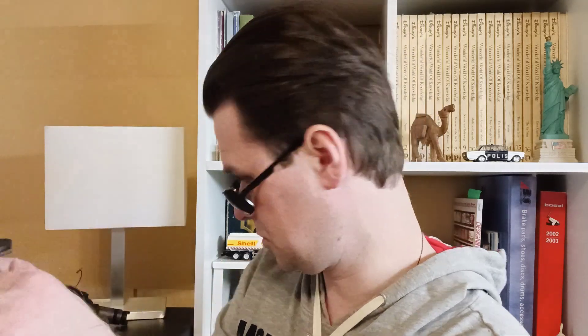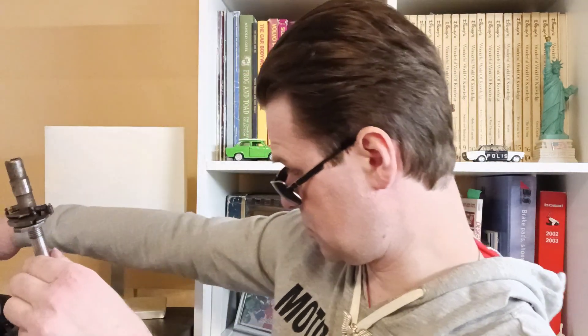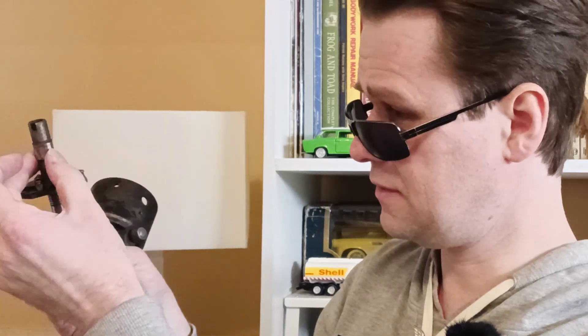When assembling, you want to put grease inside the plate, and oil the shaft through the special oil hole. The centrifugal mechanism should also have grease added. Inspect the mechanism — it shouldn't be too worn. The springs are also not available, and you don't want to confuse them because they're different — install them in their correct position. Inspect the lobes as well; they can wiggle. With a broken shaft, smooth idling is impossible.